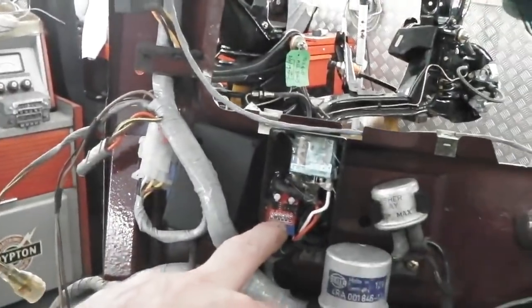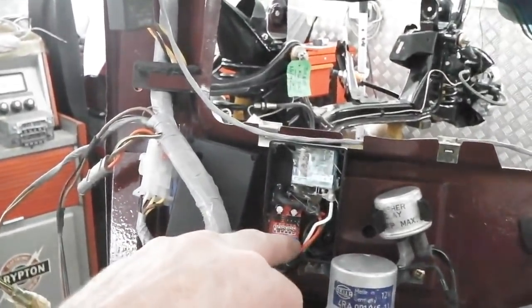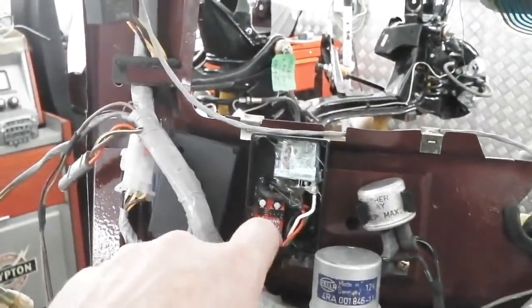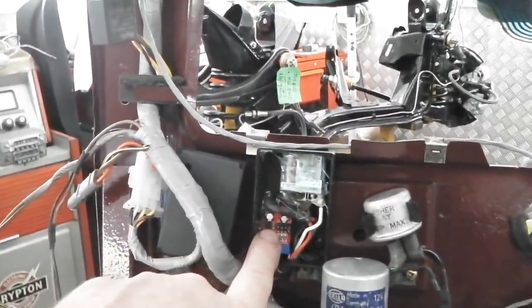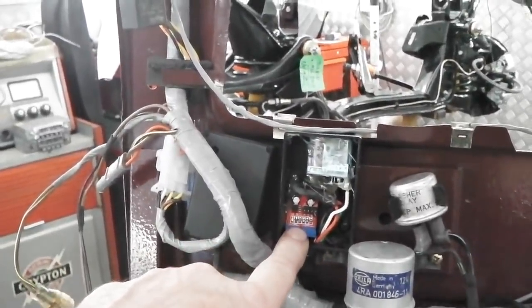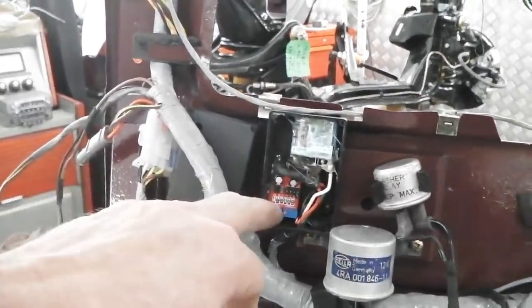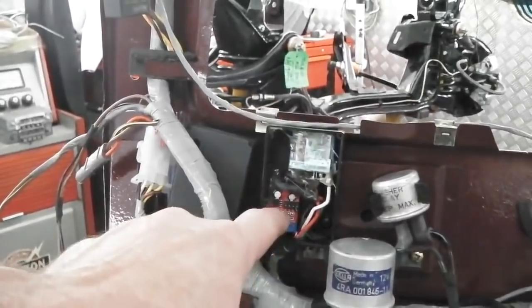A little timing board here, you've seen us use these before. These are off the shelf ones now. You can get them in kit form and solder them up. These are off the shelf, a 555, although it probably isn't. This is probably a copy type chip because this chip's customizable on its waveforms. I won't go into that, but you can have it square, you can have it sawtooth, but that's just to do with it, it's basically a pulse generator.